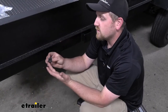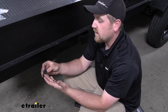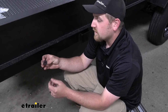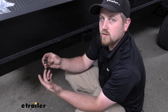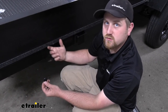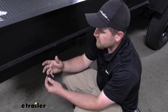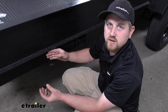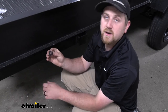Sometimes these don't always act as a replacement, but more or less something that helps you out for whatever you're doing. For example, what I use rubber grommets for — and a lot of other people too — is when you're running wiring and drilling holes through metal in your trailer, you're better off running that wiring through a soft rubber material as opposed to having it scrape on sharp metal and potentially damaging it. So that's where these can really come in handy.